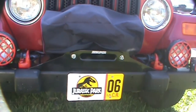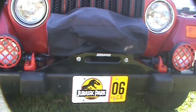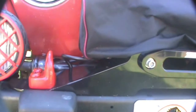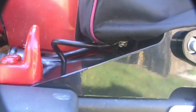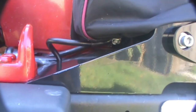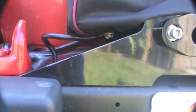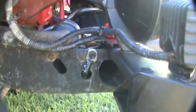This is an update several days later. Since YouTube doesn't allow me to revise a video, I'll have to edit this in. What I have done — it's hard to tell — but that is the ground connection for the winch. There are now two ground wires connected to it: the one you've already seen that goes all the way back to the battery, and this second one which loops up and goes straight to ground on the frame.